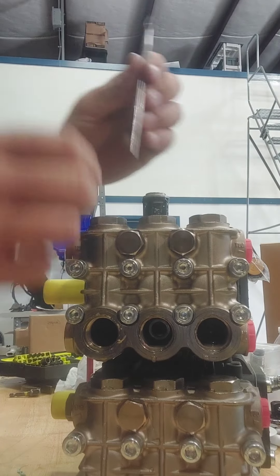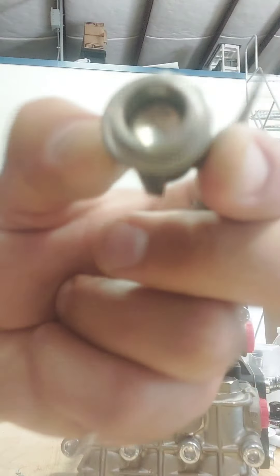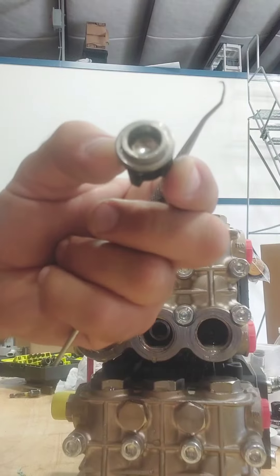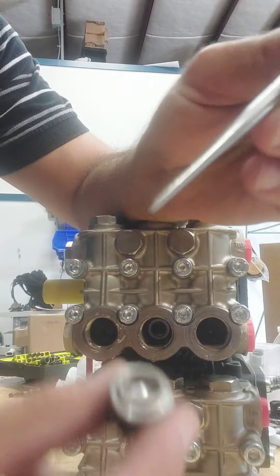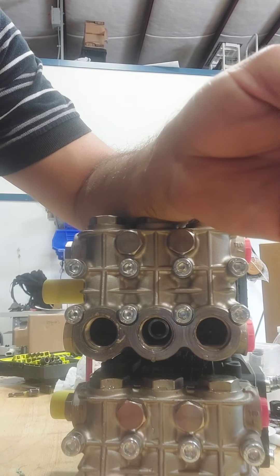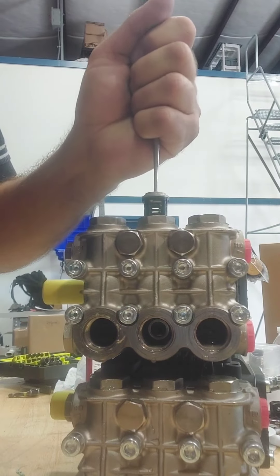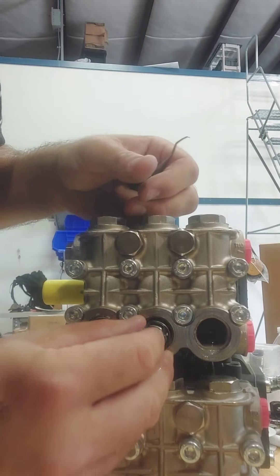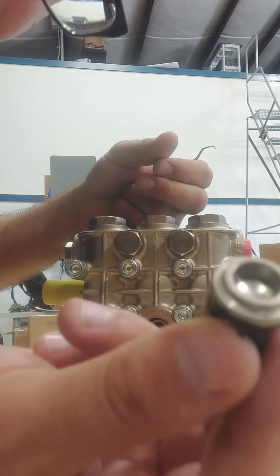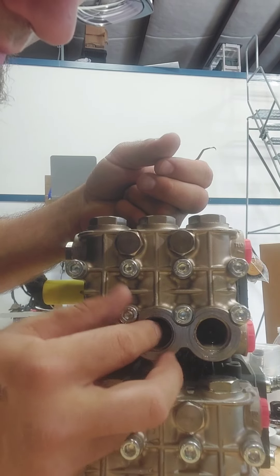You have to make sure that these move freely. This one's really stuck — it's this piece right here. I'm assuming it's either stainless or aluminum. What I use is a blunt section, not a pointy section, but a blunt section. You could also use pliers — needle nose pliers work well. I just push down in the middle until it moves freely. Now the check valve moves freely. Then you insert it back in with the plastic portion facing towards the outside.